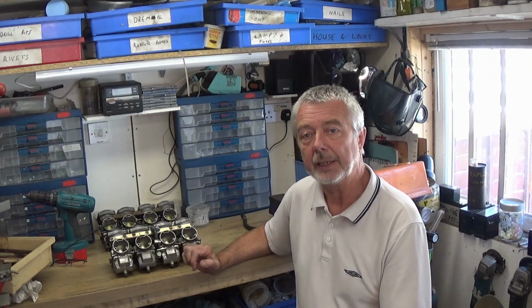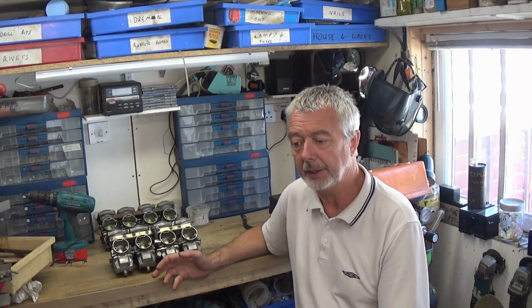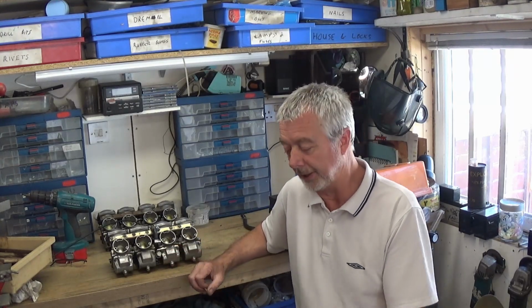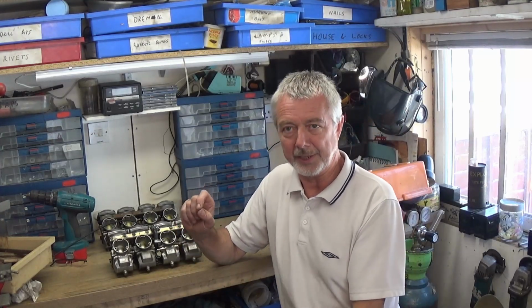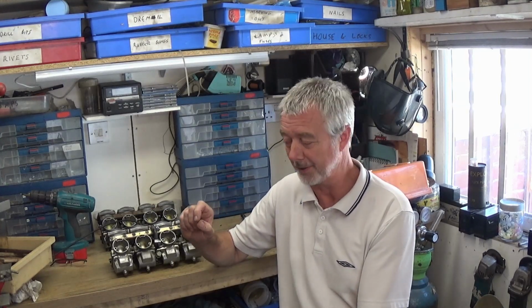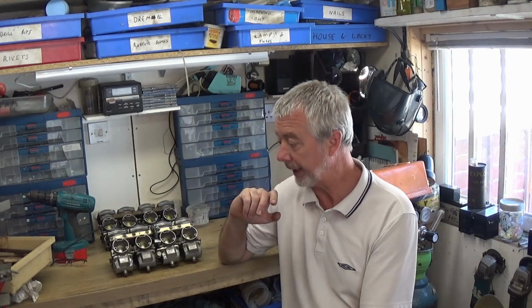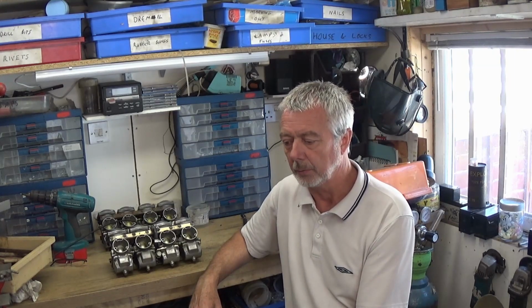So what I did the other day, I went down, had a look, checked his bike over. Compression was alright, the ignition needed the points adjusting, so got a decent spark. It's funny, the spark on the plugs when I first started was yellow, it wasn't a blue spark, and I'm surprised it was sparking at all because the points were barely opening. Anyhow, got them sorted and then it still wouldn't start very well or run. It would only really start if we put a bit of fuel down inside the carburetors and it would run for a little while.